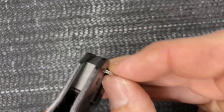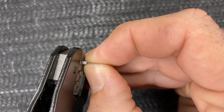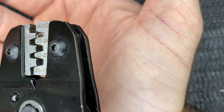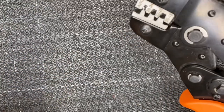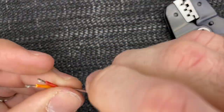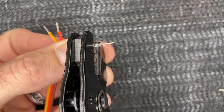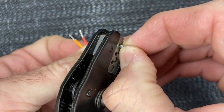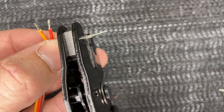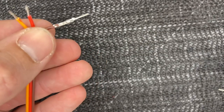If you were using the bigger area it would work fine, but I like the tighter crimp. Now on the female end I said pull it out, but on these male ends you don't want to pull it out — you want it to that second crimp right there, so it'll pretty much be flush in the other side of the crimper. We are going to start with our negative wire. Twist it nice and good so we have a nice straight shot. Then slide your ground wire in — your negative — and look on the backside. You see the wire there. We know from our test that right when it touches is exactly what we want.